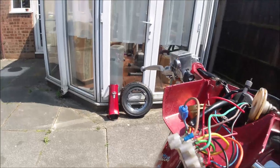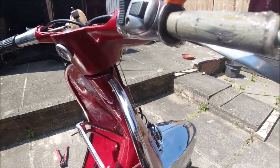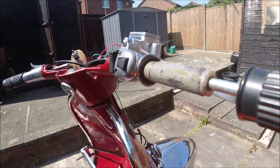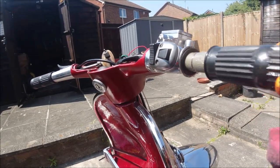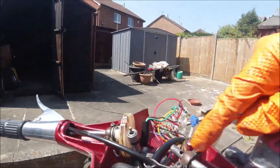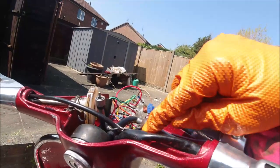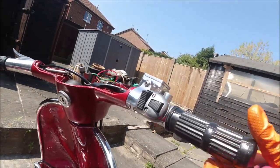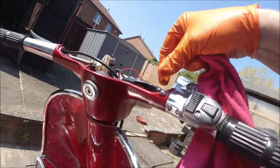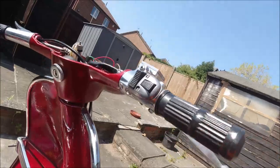There's my nylon insert on the end which gives this rod guidance. We've got our washer back in on the top — the washer is a concave shape, and you can see it move when I press on it. What it's doing is acting on this rod, taking up the slack, pushing against it — in effect pulling it. I just need to put a dab of grease under there, then put this back on. It is a tad tight at the moment so I'll rotate it a few times to find its sweet spot and put a bit of grease in here as well so it's not catching on the cables.